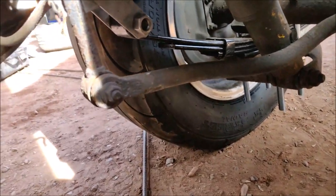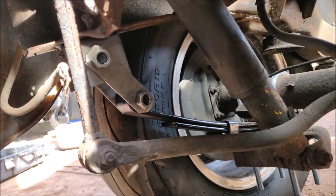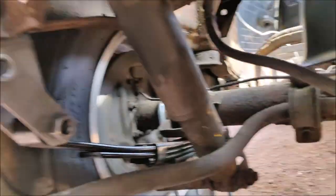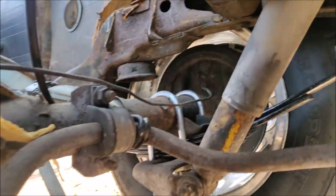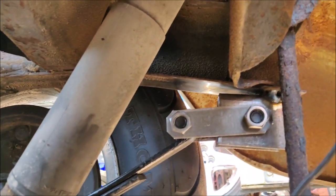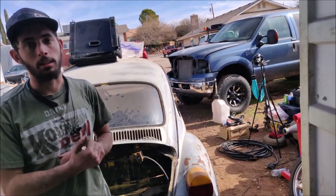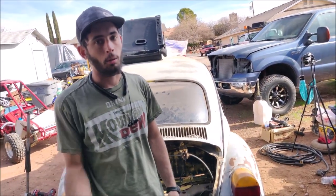What I found out is that the axle is not sitting level underneath the frame. You can see the angle of my rear shackle mount right there - it's almost a 45 degree angle which I need to fix. But if you look over on the other side, you can see it's laying almost flat up against the frame. Luckily I just tacked those in when I was getting everything set up, so they're not fully welded in. I'm going to grab a grinder, jack this up on some jack stands, cut those tack welds off, get the shackles lined up like they need to be, re-weld them in, and we'll see where we sit.